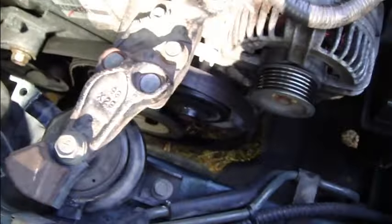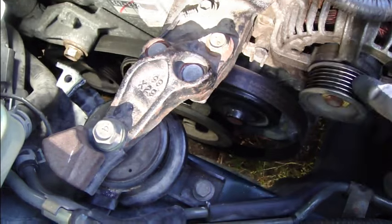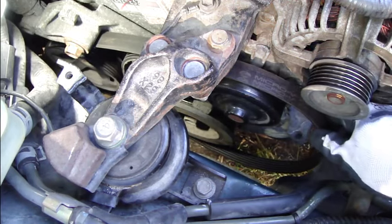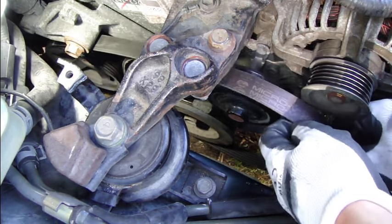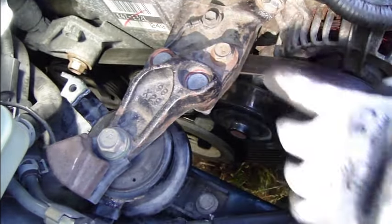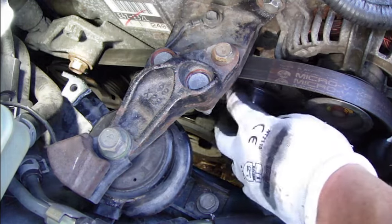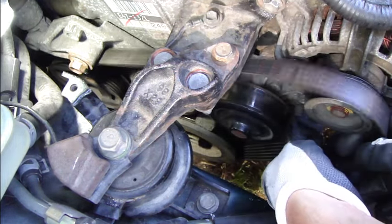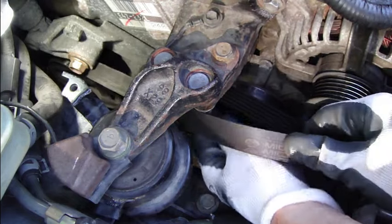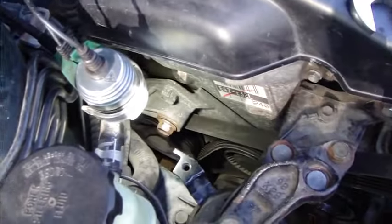This looks good. And then I have this final part, that I need to hook this belt behind this alternator disc, and I take this belt in here, and I keep this really carefully in here, and now this upper area is okay, but I only need to set up this disc in that water pump area in here, so I move this belt in this way, and now this belt is almost ready.